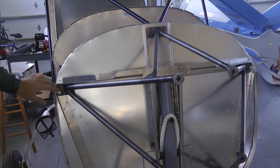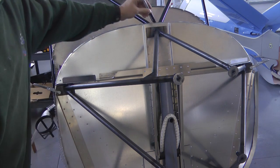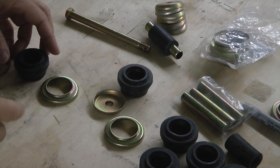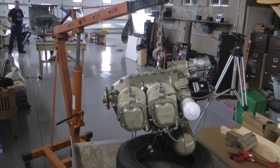With the engine mount clamped in place on the left and the right, we're then going to trace with the pen around the top pad. You can take a look at how these components go together to form our mount. Note we have the engine lifted on a hoist.